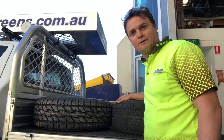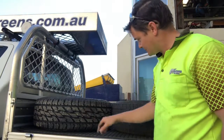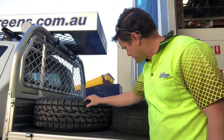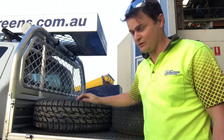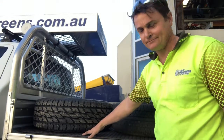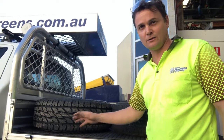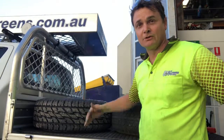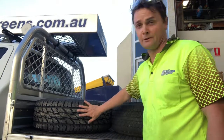While we're waiting for some paint to dry, let's have a look at the difference in the tyres. This one has much bigger grooves between the tread blocks and is much thicker in the carcass. It's actually more or less the same dimensions, which worked really well for me because I don't want to lift my tray height any higher. For most people, you can fit 33s under a Ranger or a Mazda, but I just want some good tough tyres with quality rubber on them.